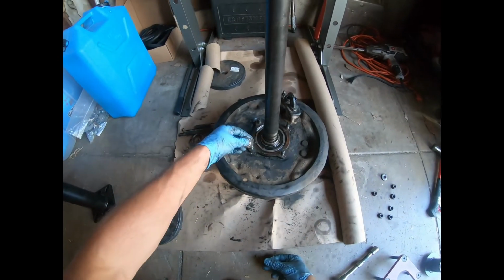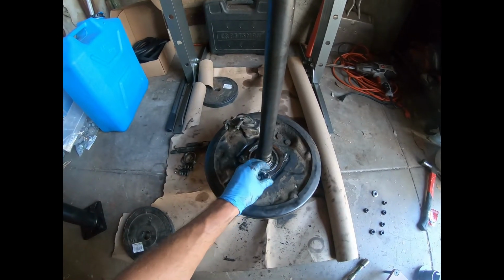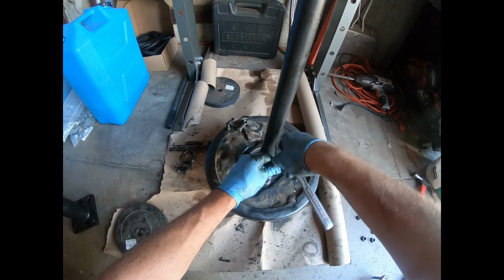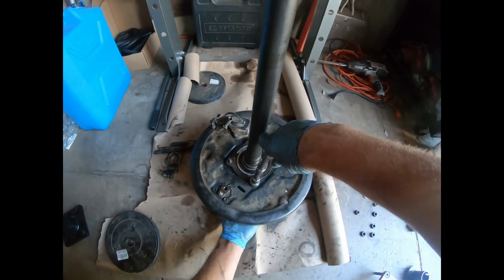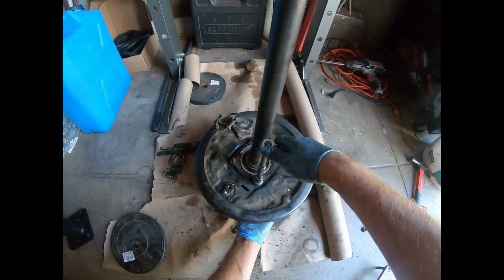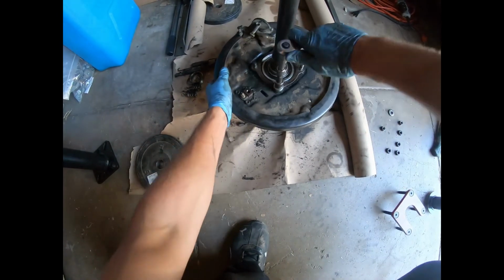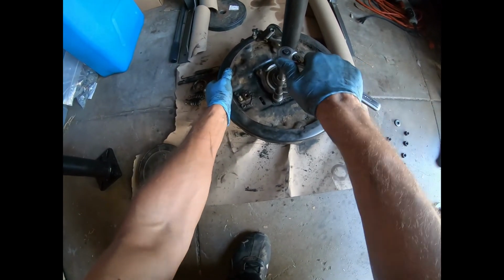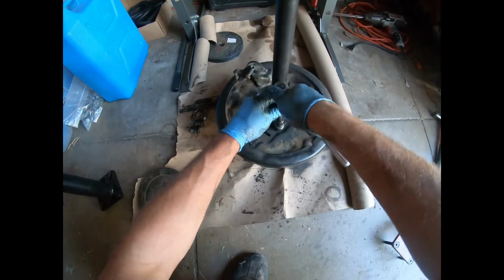So what I'm going to do is use all these washers, do these one at a time, to put some leverage right underneath the bolt, so this will get smashed between this serrated stud and the bolt. Tighten these down. You can feel in the back, I still feel a gap, so I know it's not in as far as it's going to go. All right, pretty good. Look, we got a decent amount of stud there.